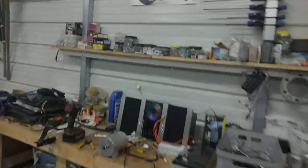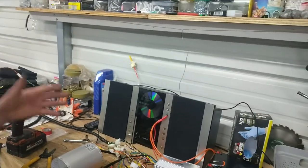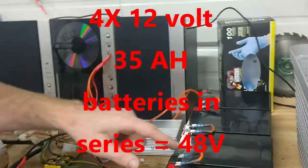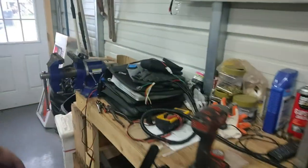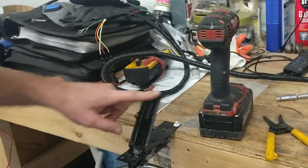Alright, we're setting up a little bench test here. We're going to see if all this works like we think it does. It doesn't really come with a lot of directions — you can go online and find some wiring schematics and that's basically what we're going off of here. We've got some loop wires on these batteries, four 12-volt batteries looped together. This is going to be 48 volts. We checked it with our multimeter to make sure, and that looks good. We have our pedal screwed down here.